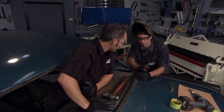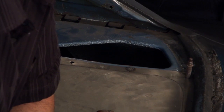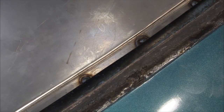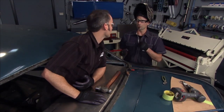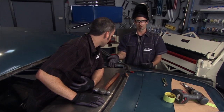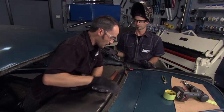Every four inches we're doing what's called a 5/16" plug weld — that's the standard auto body method. With a panel like this it's really fast, easy, and very strong. You get good penetration down between the two panels, and it also allows a little bit of flexibility so as the car runs down the road it's not all locked up — it has some room to move. This panel holds speakers, not the car structure, but it gives a lot of stiffness in plane.